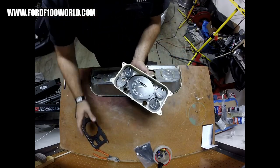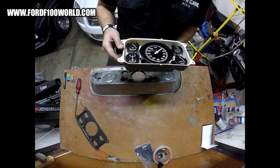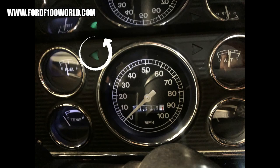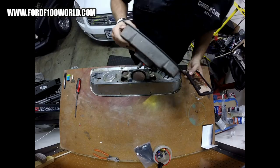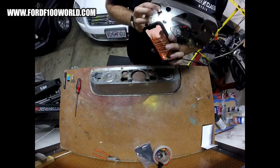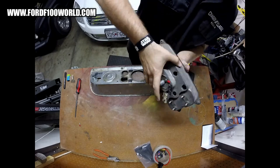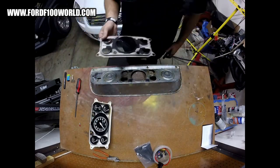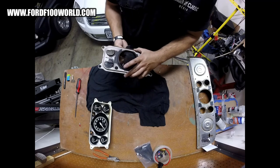This is a good time to check out the gauges. Why I busted into it: when I turn on my lights, my left signal light — I'll put up a pic — it leaked light from the gauge lights. So when I turned on the light, it looked like my left signal light was staying on but half dim. I wanted to get in there and fix that problem — trying to find out where that light's coming in at.